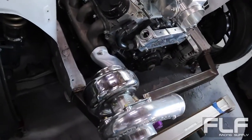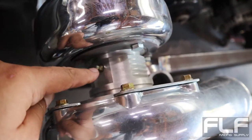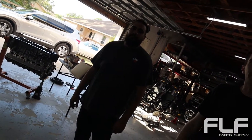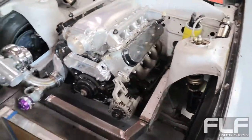Yeah, this one's air-cooled, so no oil lines, no cooling lines. They just have Zerk fittings on it. I've heard that the grease they use is actually like a helicopter grease - it's like 300 bucks a tube. It's about every 2,000 to 3,000 miles you've got to grease it, but it shouldn't take much.